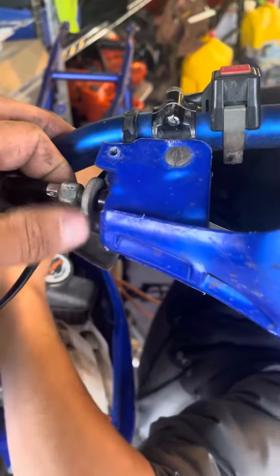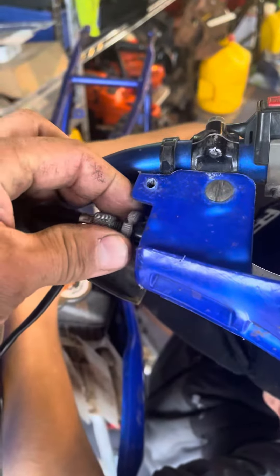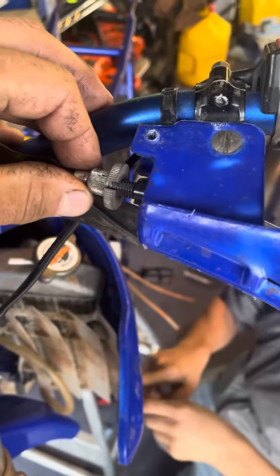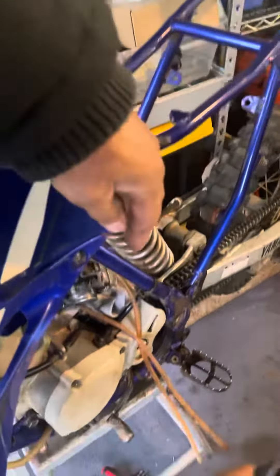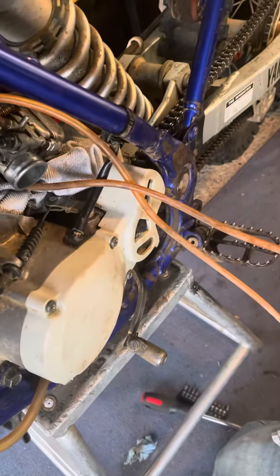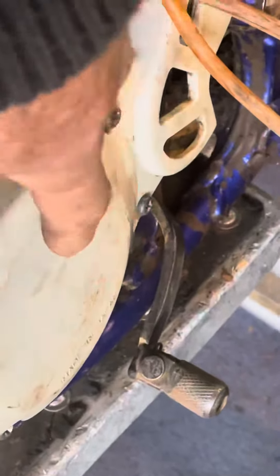So this little piece right here locks the adjuster down. You can stick a screwdriver in here and grab both pliers and basically twist that. So to start with, just back this whole thing off. You'll notice this is out pretty far and what that does is it stretches the cable out. And what it does is it pulls on this lever down here. You'll see underneath this towel that this cable is hooked up to that clutch arm right there. Now that little arm right there is what operates the clutch inside here.